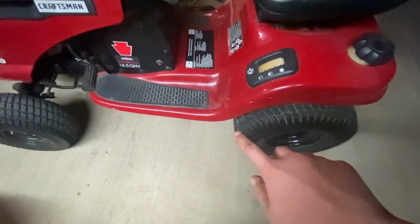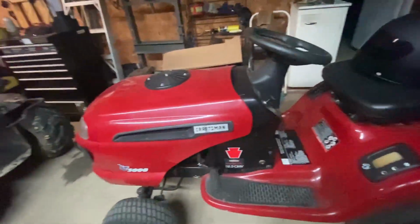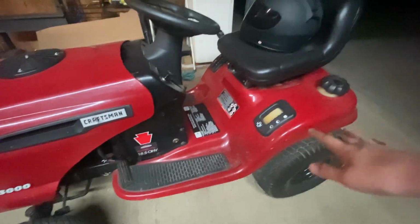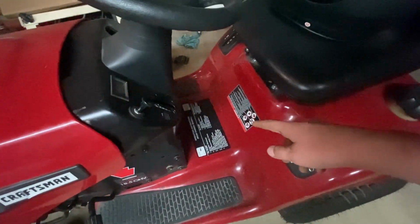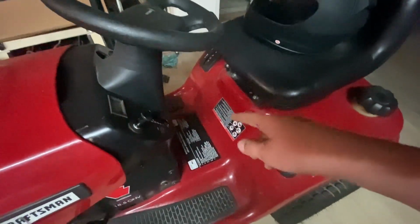And I was kind of thinking about getting another mower similar to this and slamming it, slam the transaxle into the frame, trim the fenders. Use probably that opposed twin on it with the governor. Run a 5 on the engine, and because it's slammed, the pulley will be higher up on it, not down low. Run a jack shaft right there, so a 5 to a 3 on the bottom of the jack shaft, and use a 5/8 jack shaft, so I can use a stock rear transmission pulley on top, which is a 9-inch back to another 3-inch. If you're wondering, how big is a 9-inch pulley?